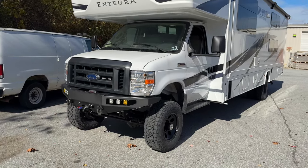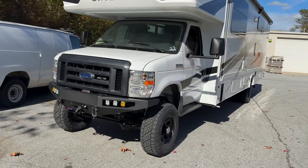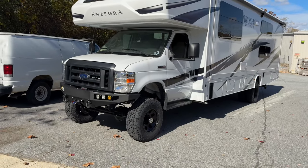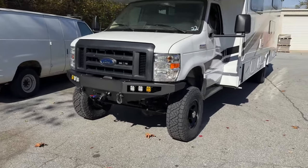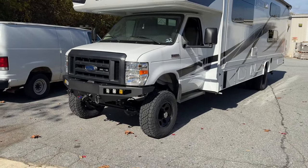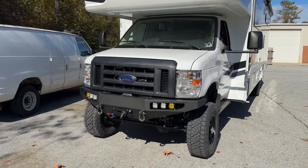All of these RVs you see, especially brand new, are undersprung. They leave the Ford factory, they go to the RV manufacturer, they add a bunch of weight, and they don't really do anything to the suspension. They might add airbags or upgrade the sway bars, but that's it — it's just a band-aid. It doesn't solve the problem of these things being undersprung. So even with some of your 2-wheel drive lifts, or a lot of your coil conversions to 4-wheel drive, still not addressing the spring issue.